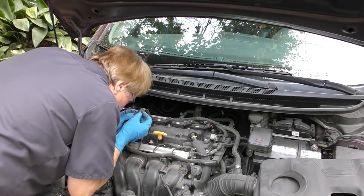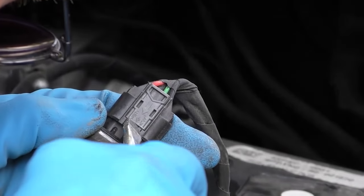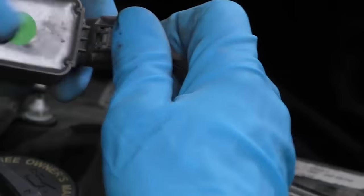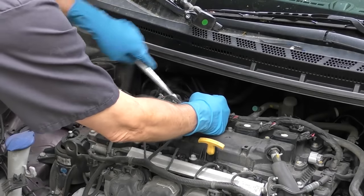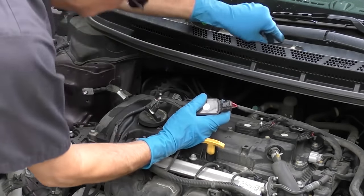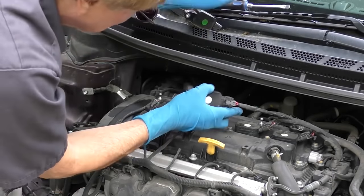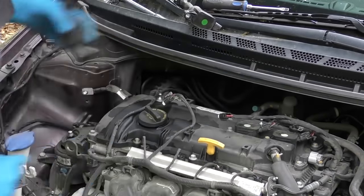In this case it's a dual system, which makes it harder than normal. You've got to click it up, then squeeze it to get it off — it won't come off if you don't push that up. We'll also take out the number 2 ignition coil: wiggle it, pull it off, get the screwdriver, unlock the tab, then flip it over and squeeze it — off it comes.